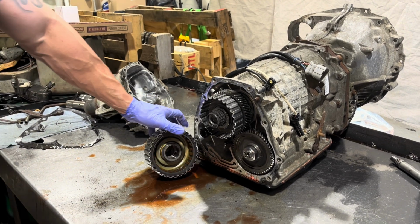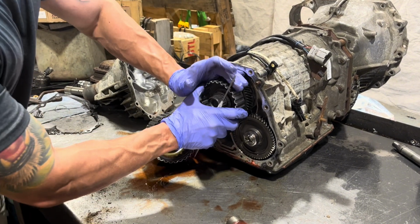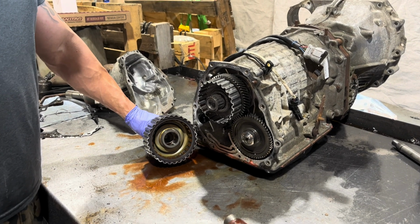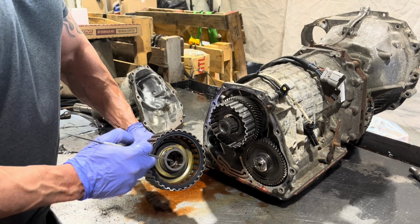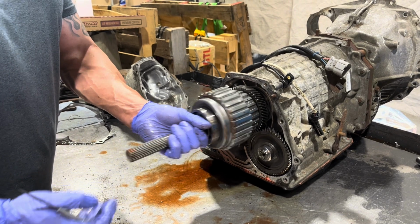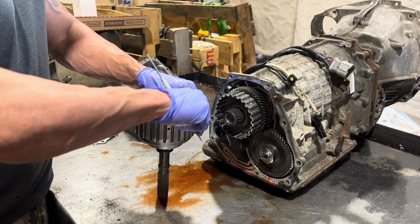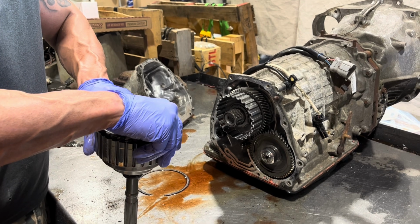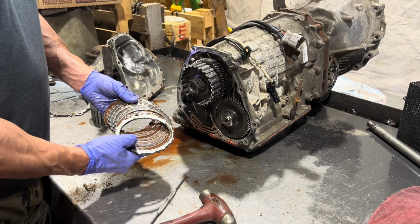Anyway, this is our all-wheel drive clutch pack. So this thing is always a front-wheel drive. It's turning. This pinion shaft goes up to your front wheels, and now your system that transfers the power from the wheels that slip to the wheels that grip is just a question of a solenoid pulsing this clutch pack on as needed and sending that power to the back wheels little by little. Not an ideal system because it's not proactive, it's reactive. So when you guys have upgraded vehicles and bigger turbos and you're spinning the tires, this thing's trying to add power to your back wheels with varying degrees of success.